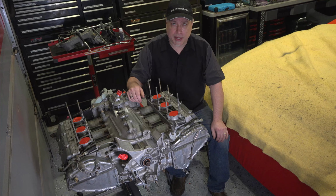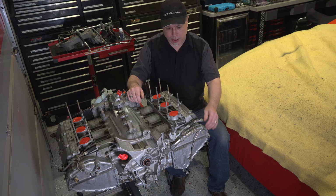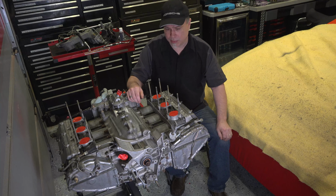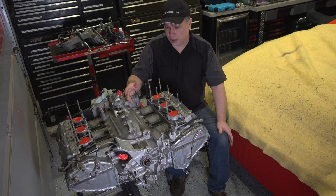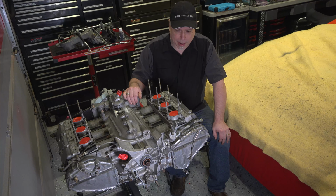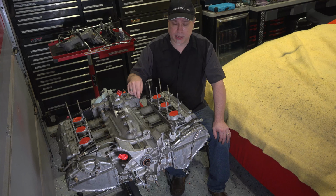So I think the next thing to do is to pull off the cam covers here. I have a Carrera hydraulic chain tensioner, so anything that's a rubber part or something like that's probably going to be a little compromised and probably need to be changed. Originally I thought I was just going to kind of do a freshen up on it, and it doesn't really look like that's going to happen because you've taken it down this far, and you'd be kind of a fool not to change everything. So, front and rear main seals.